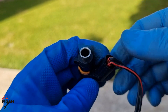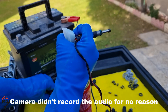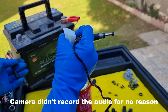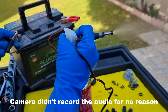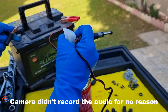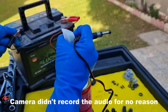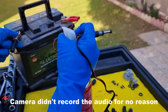Now we can put each wire on each pin — it doesn't matter which is positive or negative; it's a coil and it works both ways. Hold the fuel injector along with the adapter and push it down on the carb cleaner, and at the same time give it 12 volts. This is called fuel injector leaking — it shouldn't be spraying without power. It means carbon is stuck between the nozzle solenoid and is preventing it from closing. We'll give it continuous long bursts of power to clean it. After cleaning, rinse with carb cleaner and give it power to release the pressure.